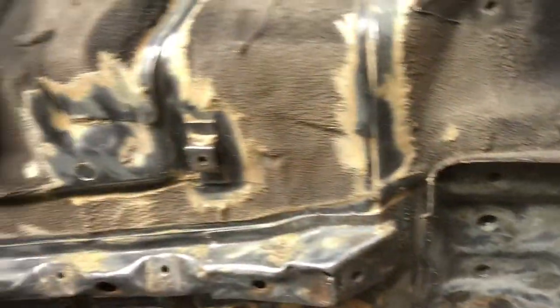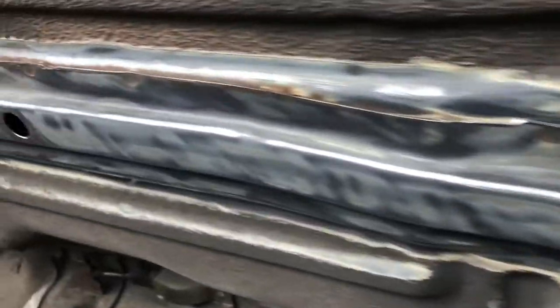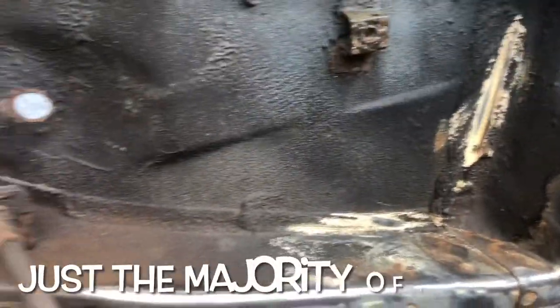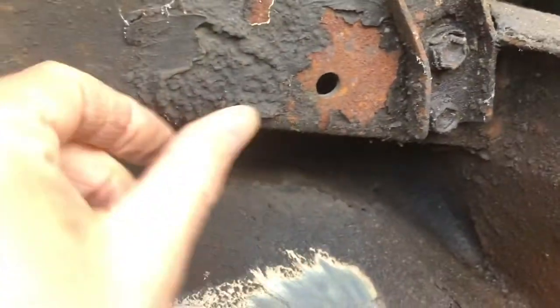Apart from that, it's not too bad. And obviously this is all being removed just to get sandblasted afterwards, because you can't get into places like that. And this is important — very important — because this is the structure of the car. Places like here, the seam sealer — you pull that back. It's been on 30 years, take it back, do it properly. I don't think I'm going to remove the seam sealer from the entire underbody, just from where we think it's gone.